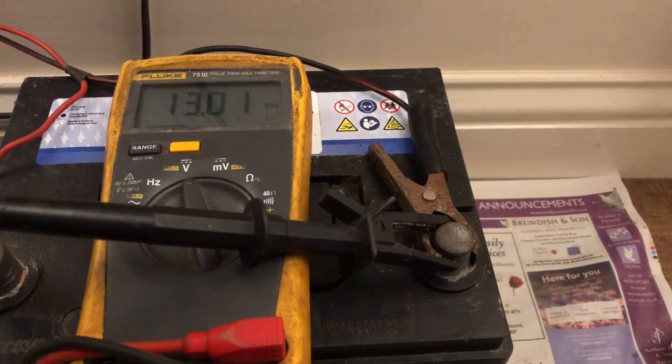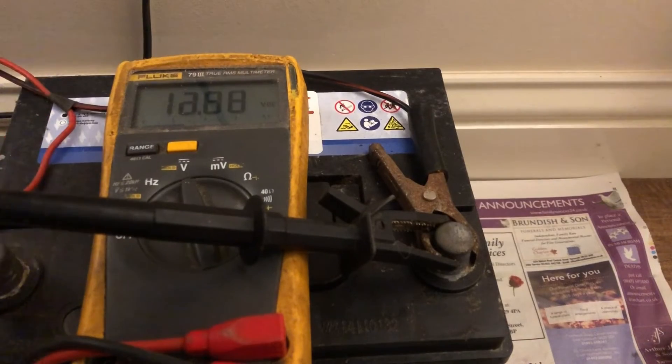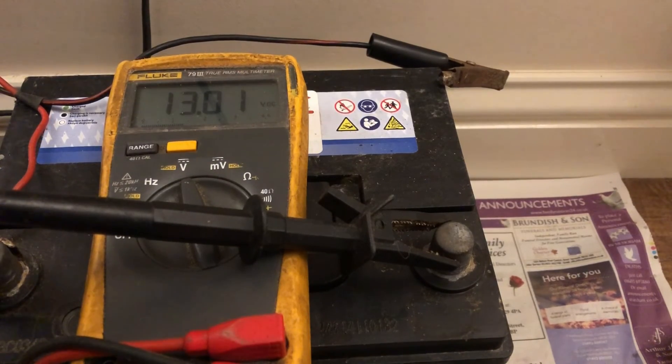As I was saying, if a battery has just been charged, a little extra voltage in it makes it seem higher than its true resting state. But once you put the charger on, it'll go up a couple of volts. In your car the alternator will bring it up to about 14.4 volts, the alternator in your boat will also go up around 14.4 volts, and the solar panel will go up to about 18 volts. I'll turn the charger off now — you can see the voltage is going down pretty sharply and after a while it'll settle back to about 12.8 volts.